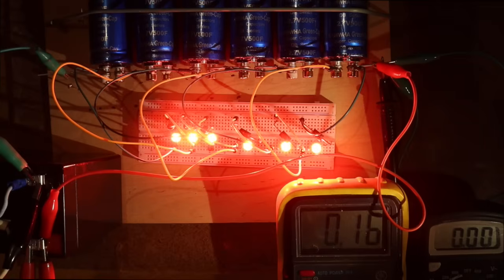But okay, we see that with every discharge and charge cycle, the equalization seems to go better, because every discharge and charge cycle is a current flowing into the combination of the capacitors and diodes, which for every capacitor is then an occasion to change to the right or the left in the capacitor or in the diodes, and so it's an occasion to correct itself.